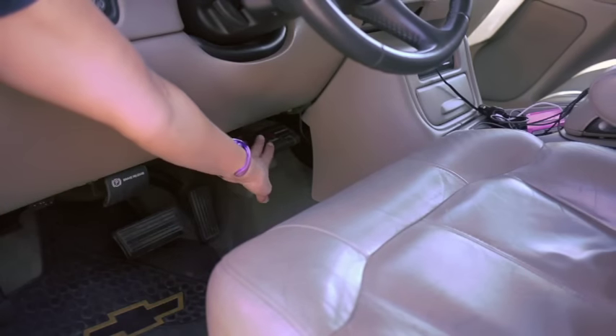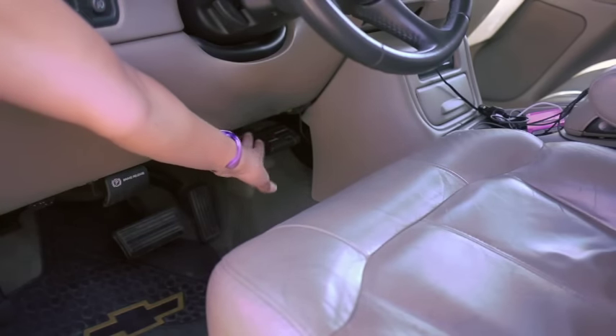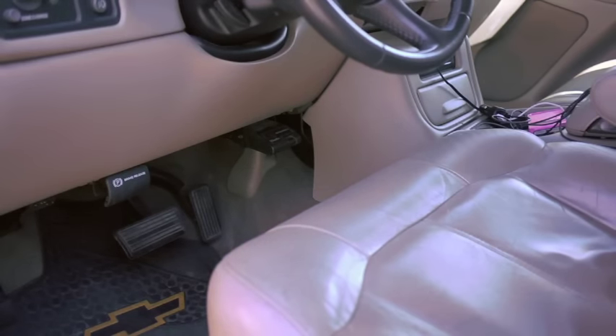This right here is my electronic trailer brake control switch or box. What this box does is it tells the trailer's brakes how much power to use. The faster you're going, the more power they're going to need; the slower you're going, the less power you're going to need. Almost all of them will have either a dial or a button for your gain control.